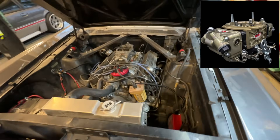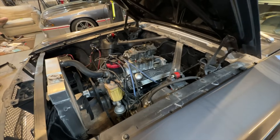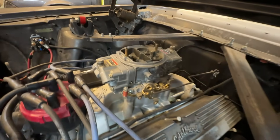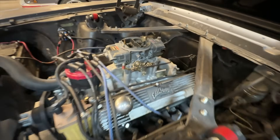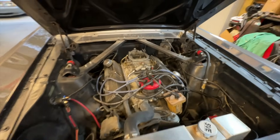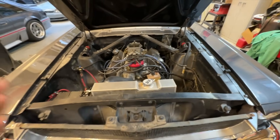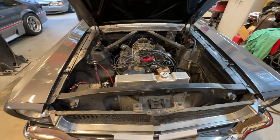We're going to put some new plugs in at some point, and we've got a new carburetor coming - I'll throw it up on the screen - it'll be a new ATM billet carburetor in the gold finish. We're changing carburetors because this one has given us trouble from day one. You can drive it, but it's got a stumble we cannot get out. We've played with power valves, jetting, cams for both front and rear barrels - everything - and just can't get that stumble out.